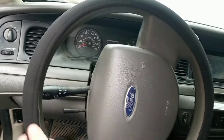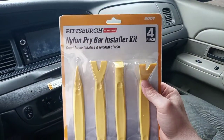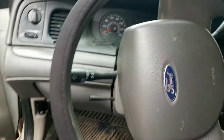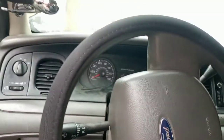So now it's up to me to pull all that apart and send the dash cluster in to be refurbished. Before I did that, I went down to Harbor Freight and bought a nylon pry bar installer kit, because you've got to get in here and pry some stuff. There are also some 7mm screws — one here, one here — that you've got to pull first.